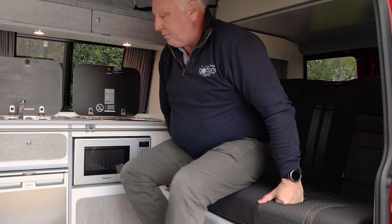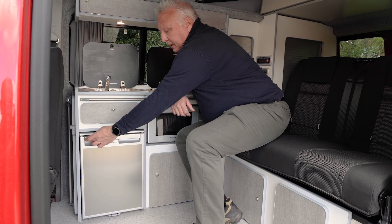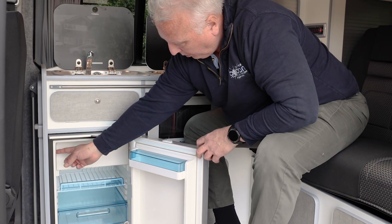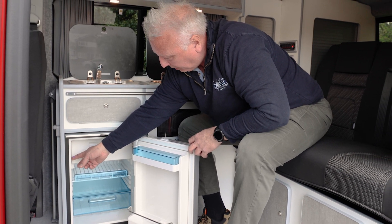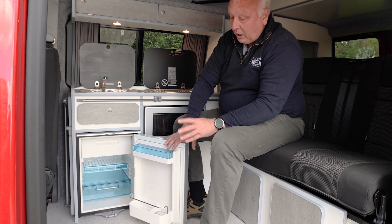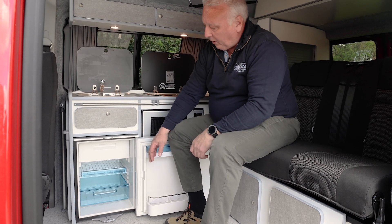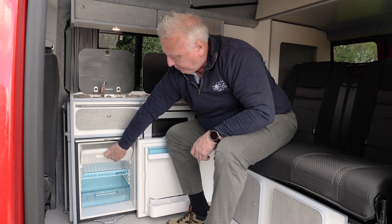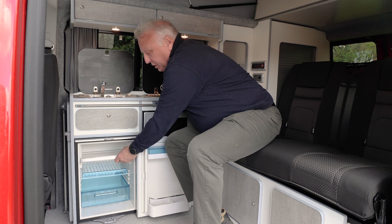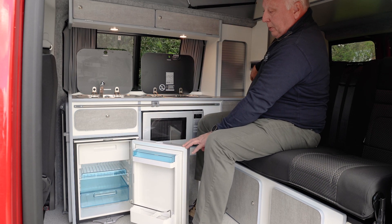With the fridge, in most cases the door opens this way. To open it, go to this little sticker here, hands underneath, lift the tab and pull. The temperature gradients are there with a toggle button at the bottom — keep toggling through until you get your desired operating temperature. As a rule of thumb, the larger the spot the colder the fridge gets. The Dometic CRX50 comes with a freezer box as standard. If you don't want a freezer box and you want more fridge space, just open the door fully and withdraw it from the fridge and store it somewhere safe. If you're not using the fridge for prolonged periods, obviously turn it off at the panel.